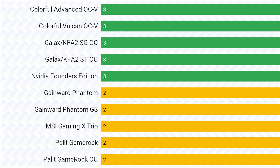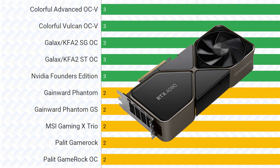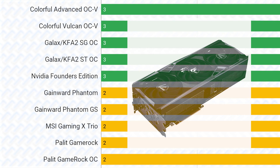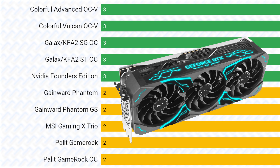The A tier cards are what I feel are as good as it gets for someone that wants a plug-and-play experience for the best cards without any real interest in overclocking. The NVIDIA FE is an outlier here as it really has a cooler more in line with the B tier cards. But the cooler itself is probably the best-built cooler out there and its PCB is very well-engineered as per usual from NVIDIA's Founders Edition cards. On top of that, it has a maxed-out 600W power limit that's really awesome to see in an FE card. On the other hand, the Colorful Vulkan really should be an S-tier card, but its power limit at just 495W is a joke for a flagship card — it should really be 600W. The Colorful Advance OC and Galaxy cards are perfectly fine options for those not overclocking.